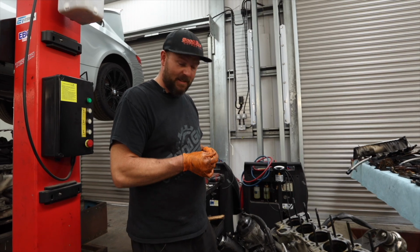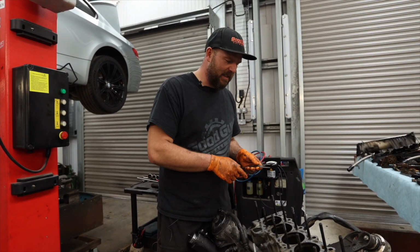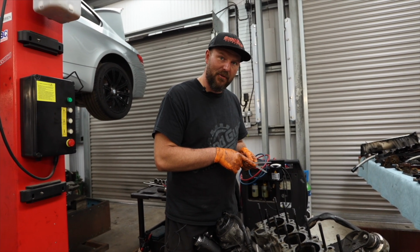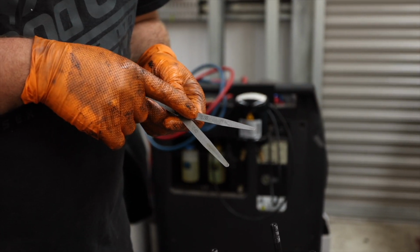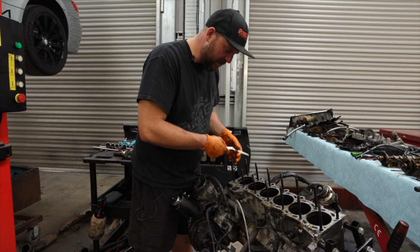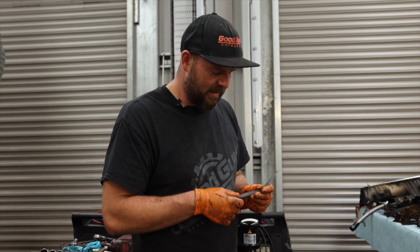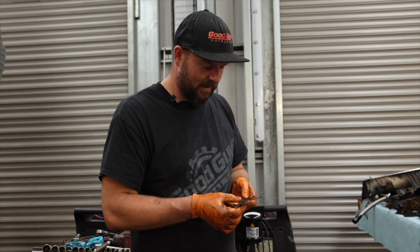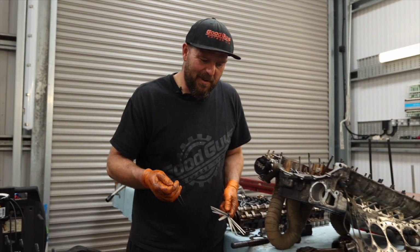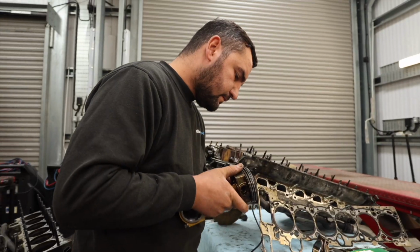The way we'll do this, so we've got the specs of turbo piston rings for this engine. Recommended is 0.483, so long as the 0.4 goes and the 0.5 doesn't, or certainly the 0.6 doesn't, then we're winning. 0.6 does not go, that'll be fine. These rings have been gapped already. That is outstanding. You'd rather too big than too small, because if it's too big, you'll get a little bit of smoke and a little bit of oil burning, but that's acceptable.